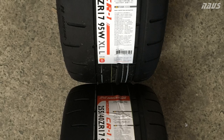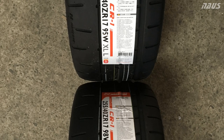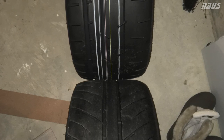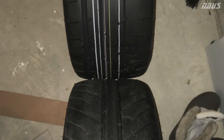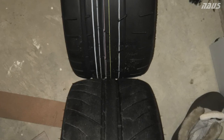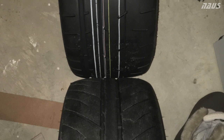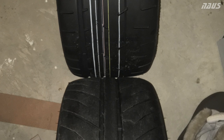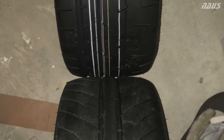Here's a top view of them next to each other — it's a little harder to tell the difference, but the 255 is a tiny bit wider as expected. At home, comparing the 245-40-17 to my RS4 from a top-down view, the tread widths look nearly identical. This just shows how the 245 CR1 runs a little wide for Nankang. I imagine this is the same with the Yokohama AO52, and I also heard the RT660 from Falken runs just as wide — so be prepared for that when fitting under stock or modified fenders.